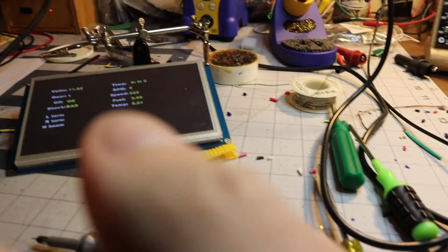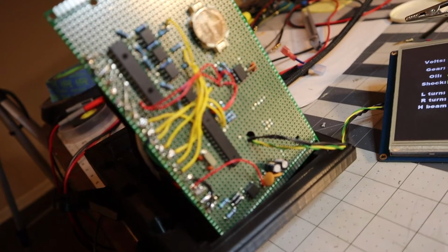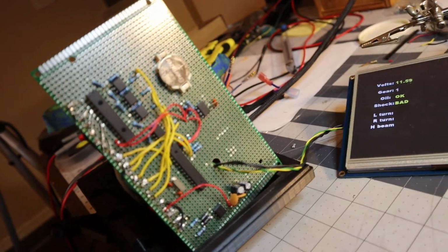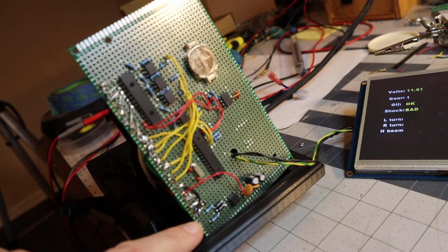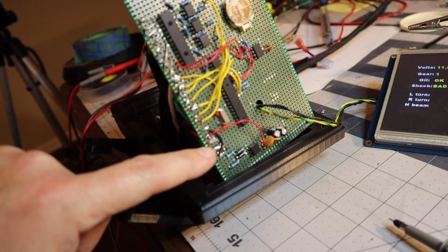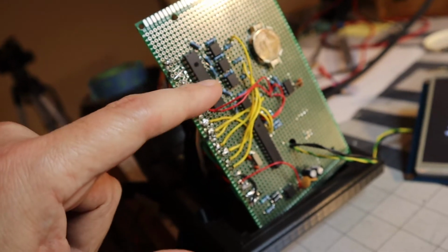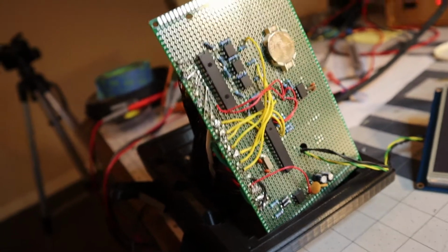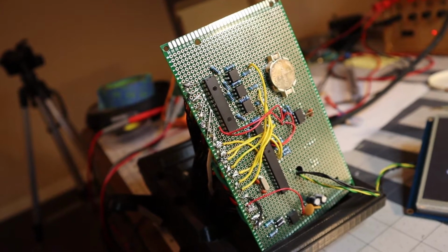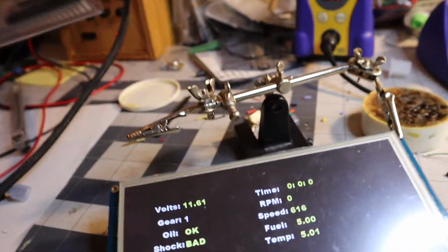So, what I think happened is I fried the multiplexer, because when I was hooking this up to the bike to see if I am detecting the RPMs correctly, I had it upside down and was hooking up the wiring, because that's ground, ignition and 12 volts. So basically I was hooking it up from the wrong end, so the zero bank got 12 volts pushed into it, and the absolute maximum for this guy is 6 volts, 5.5 plus 0.5 fluctuation, so basically 6 volts is all that it can handle. So we fried it, but luckily I have one more.